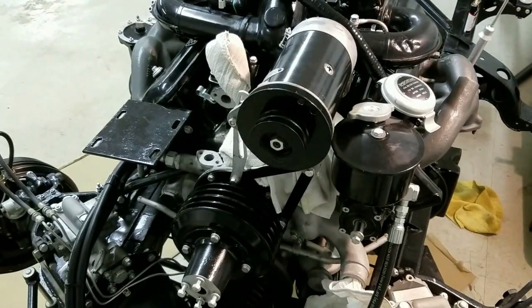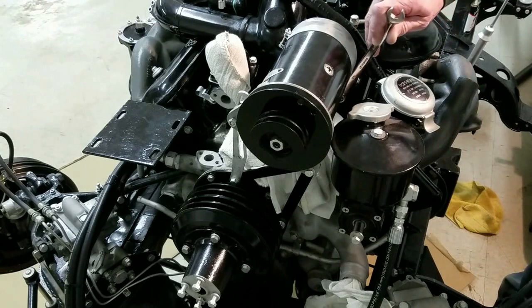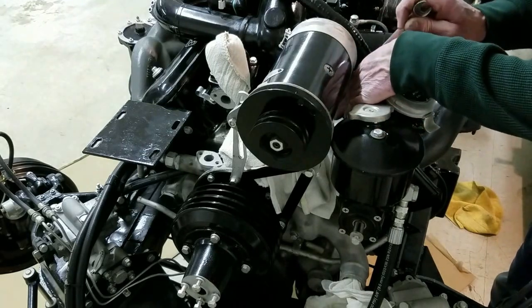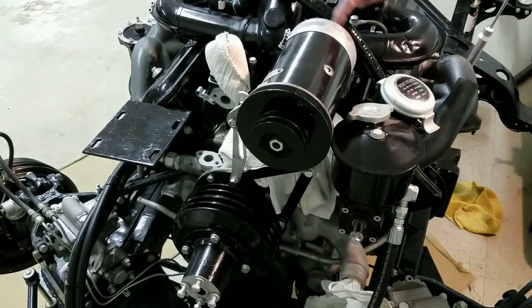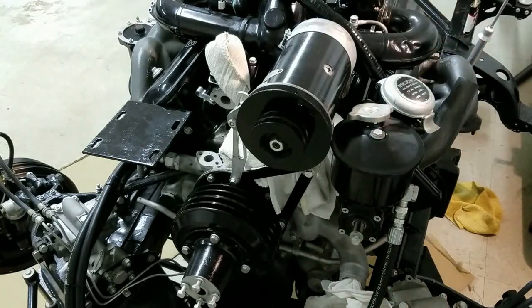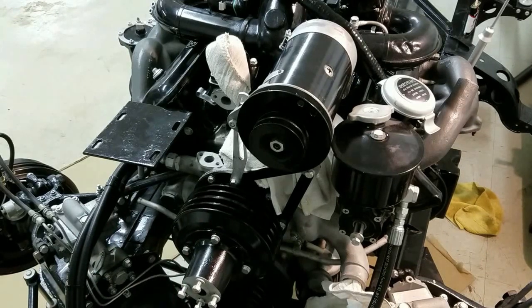I don't know if you can see the back of that generator, but I went ahead and put my bolt in from this side because it's easier to get to. I put a bolt on it, then a washer, then a lock washer, and I'm tightening it down. I snugged all of these up. I did not put the wires on the back — I usually do that before I put it in because it's a bear to get to that lower terminal. But I went ahead and put it on anyway. I'll make do with it when I get the belts on.